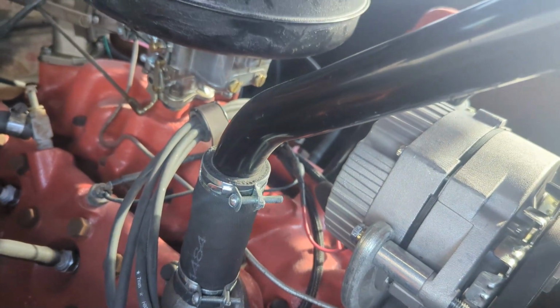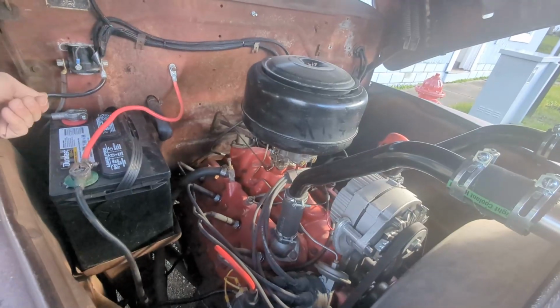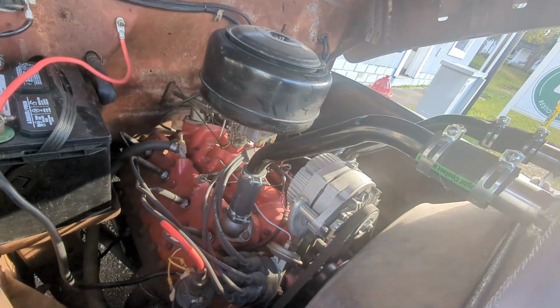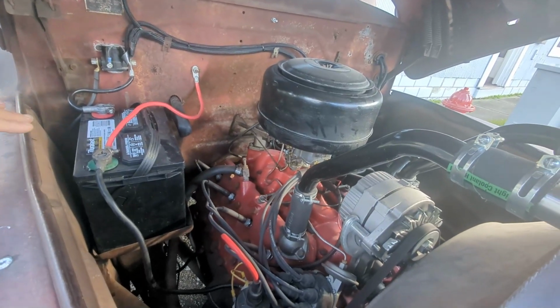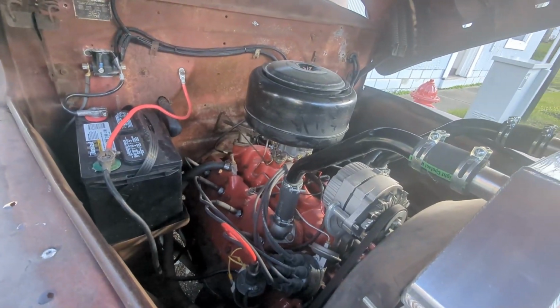Excellent. So even at idle. And how we tested that was we just stuck the wire to the positive terminal so you could watch the battery. It's like 12.2 volts, and then we'd touch the wire and it'd go up to 14.5. Yeah. So now the alternator is going to be charging that battery all the time when you're driving it. Outstanding. All right, sounds like we finally got it licked. I think so.